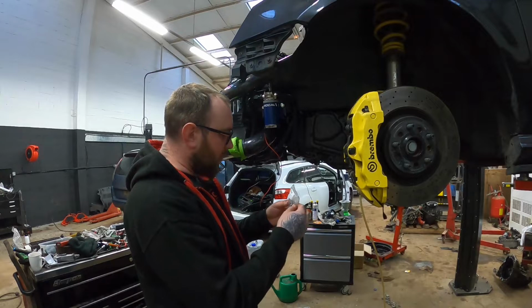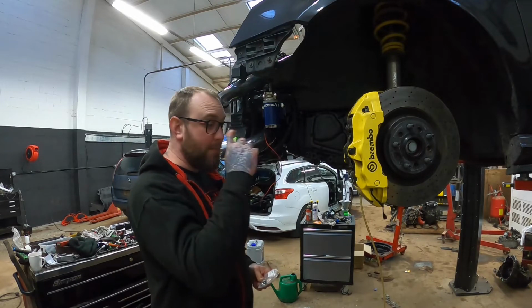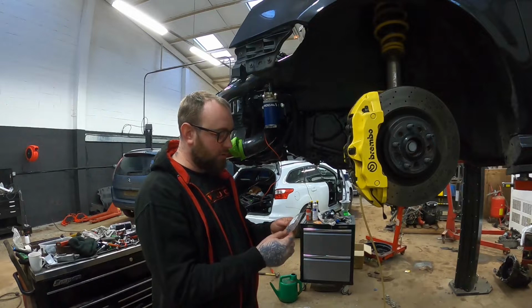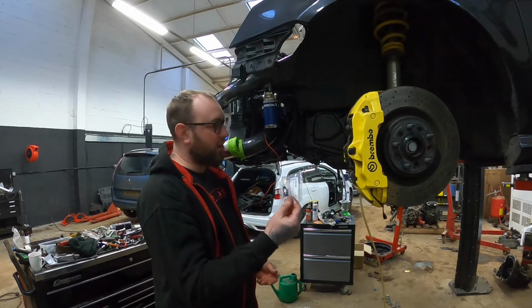It's a 1/8 MPT thread. So you could weld a fitting into the sump and do it there, or I have got one of those aluminium oil filter housings. That actually has a 1/8 MPT there as well, so you could put it there. So there's a few different places you could put it if you wanted, and then it'd be triggered by temperature.